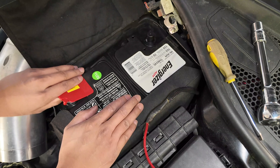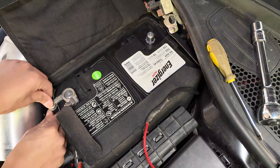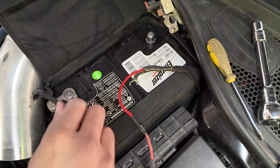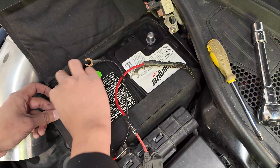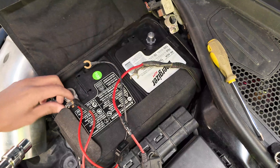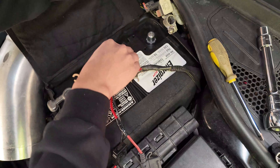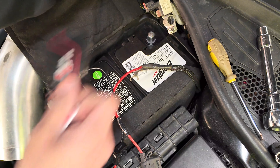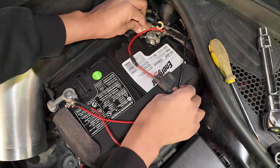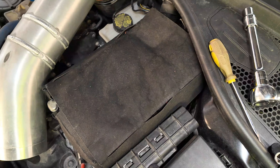Take off the battery terminal covers. The first terminal we connect is actually going to be the positive terminal — make sure it's on and nicely seated. If you have any additional electronics to plug in, now would be the time. Tighten it down with the 10mm socket — make sure the terminal is not loose when you try to manipulate it, but no need to over-tighten. Next, connect the negative side terminal. There may be a chance the alarm goes off, especially if your car has been dead for some time — don't be alarmed, make sure you have your key handy. Tighten it up with the 10mm and tuck in everything — you're all set, the battery is back in the vehicle.